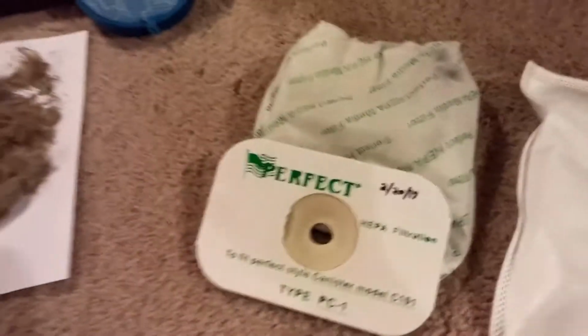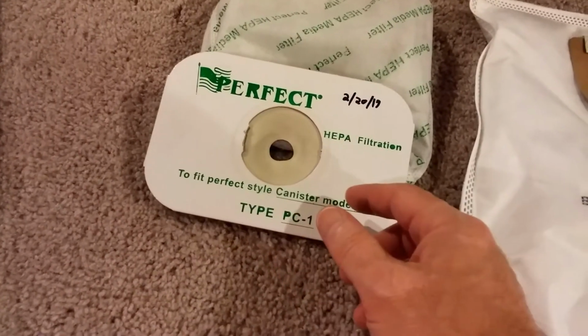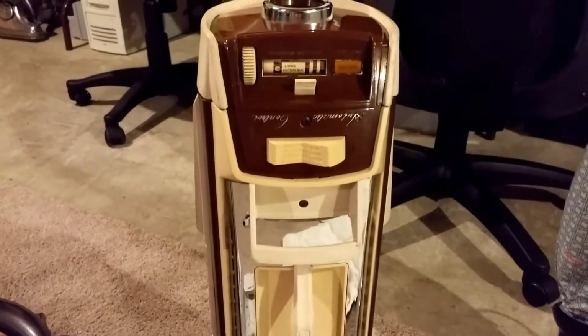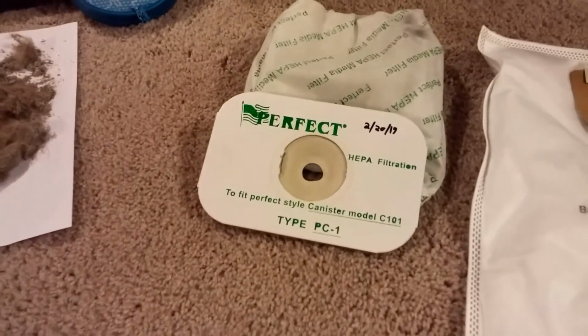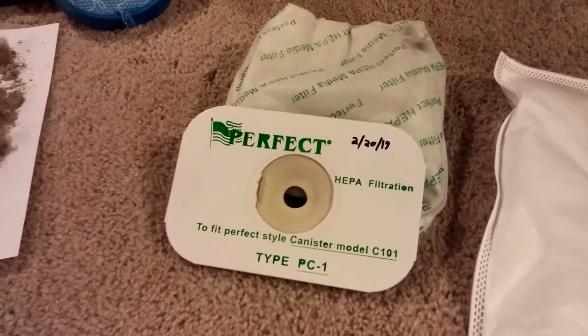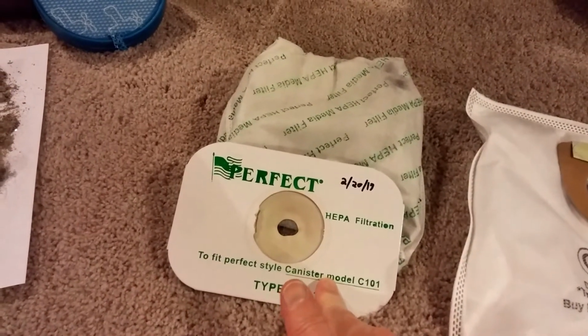So with this bag, you've got to be careful. You could end up filling up the bag and also filling up the hose. You could end up filling it up a couple feet into the tube, and this thing would still never pop. So you have to check the bag, because this thing has been chock full of this type of dirt, and it just won't pop. So to recap, 7 CFM loss from empty to full.